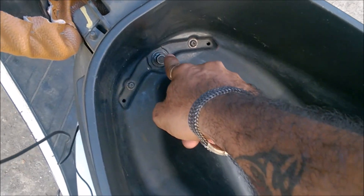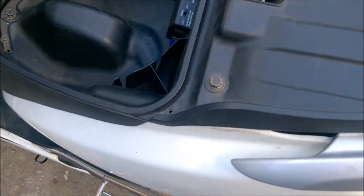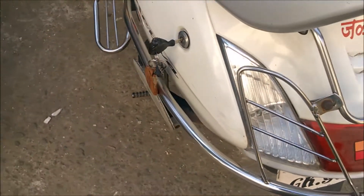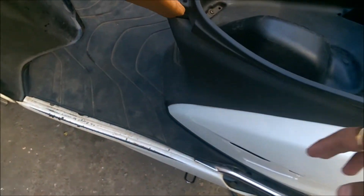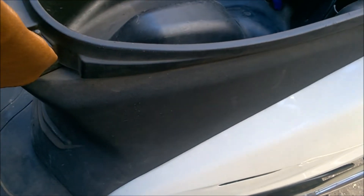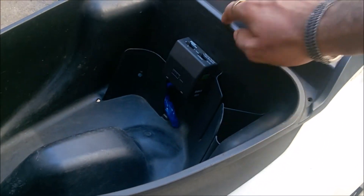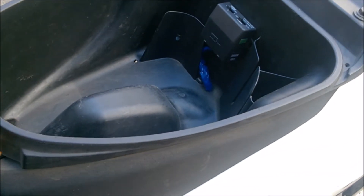What you have to do is remove this bolt, this bolt, and this bolt. If you have guards installed on your Activa, remove these two bolts as well. Then lift this hood up and use the stand which holds the panel upright. After that, you will have a hood release wire underneath — you have to undo that as well, and then this whole panel will come out.